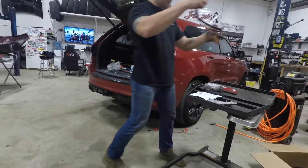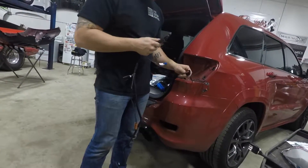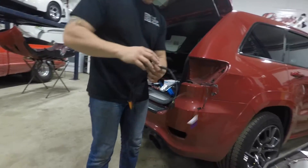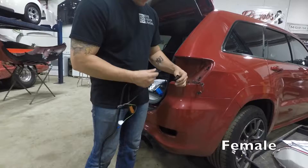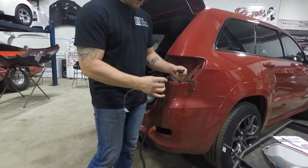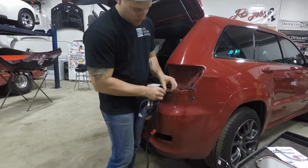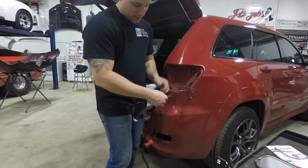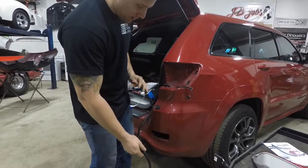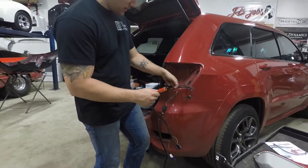Now to the harness. Your main plug is right here — this is going to be your brake light, turn signal, and running light connector. That will plug into this female connector; this here is the male connector. They line up pretty easily — it's easy to tell which is which — so just press that in there and push down the locking clip to make sure it's nice and tight. This one is going to go back into the tail light, and then you'll feed the resistor down into the bottom.